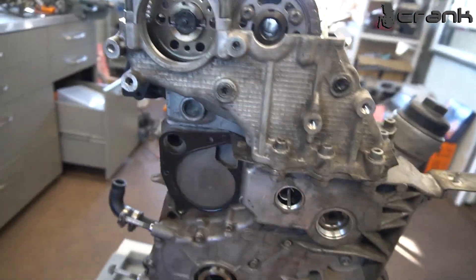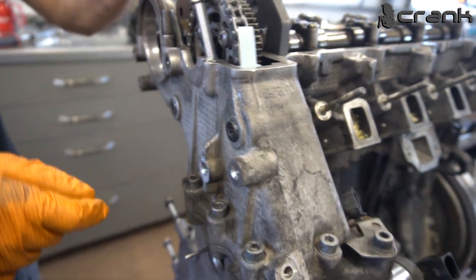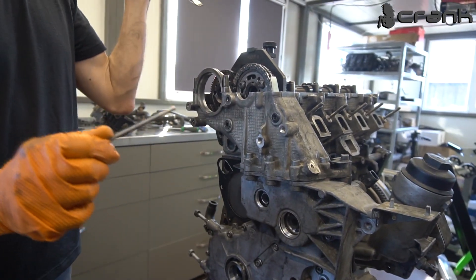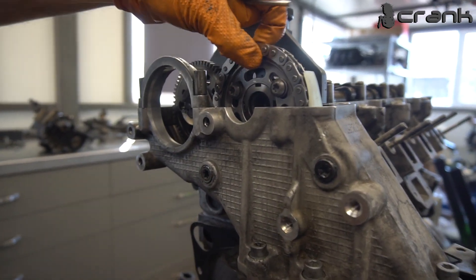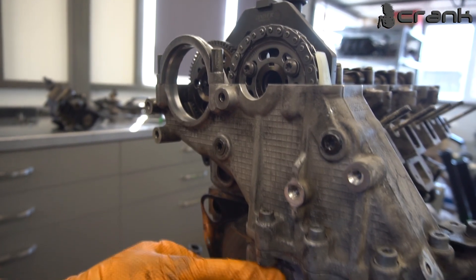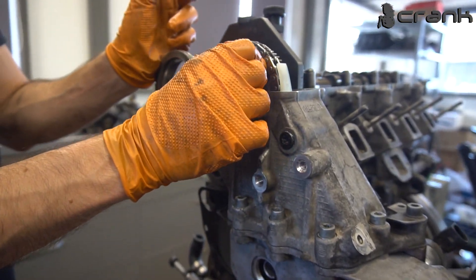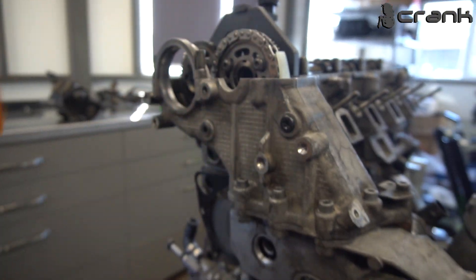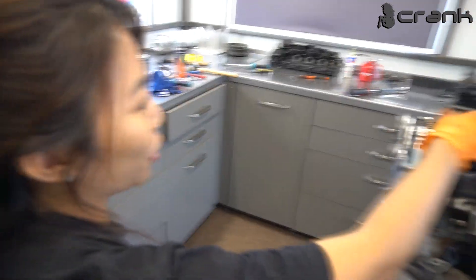Now the chain has no slack — as you can see it's stiff. It will get stiffer when there is oil pressure inside, because right now it's only tensioned by a spring which is not so stiff. But now we are safe to tighten up these two bolts. After we rotate the engine we're going to install the third one, but for now the two are enough.